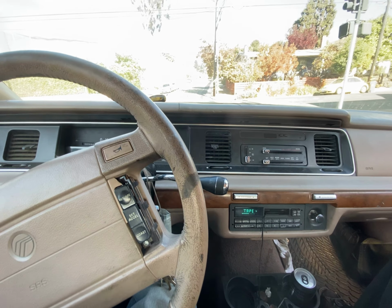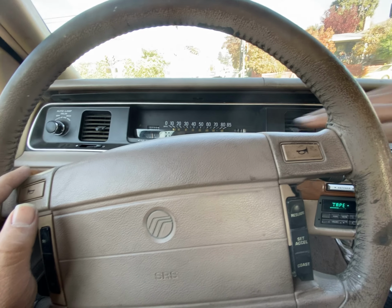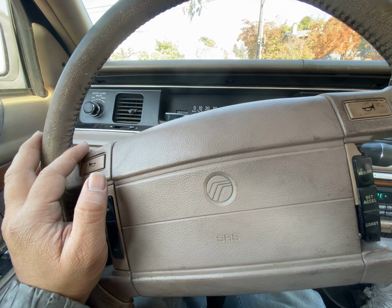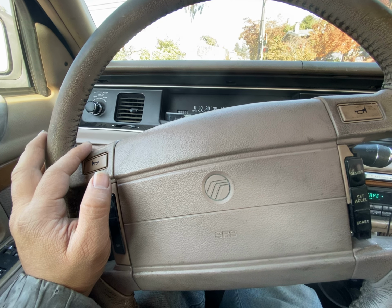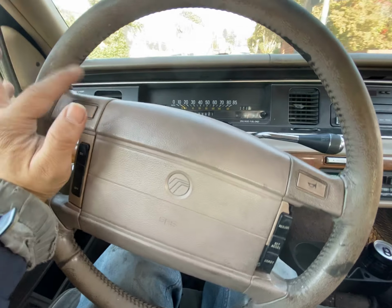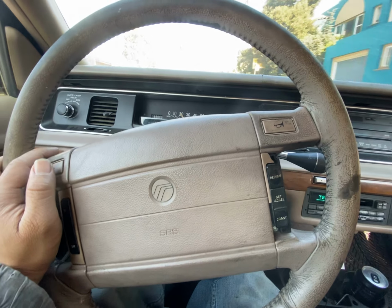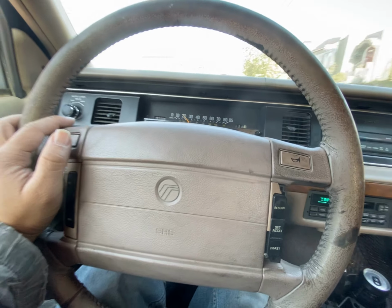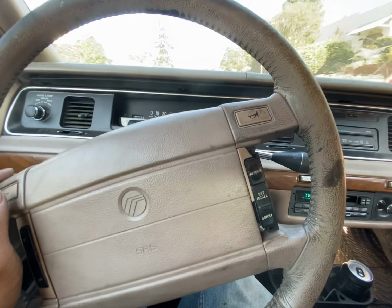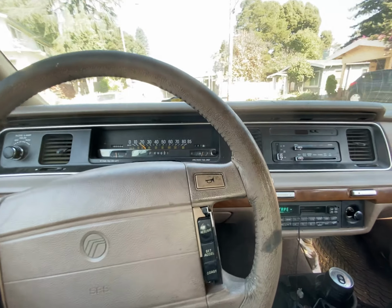And I was thinking it might be a wire, because you know how this gauge here has nothing to do with the ECU. That's a completely separate system. And that thing fluctuates way faster than the coolant temperature could change. So normally there's one system just to tell you that, and the other one tells the computer what the temperature is. There are two separate sensors. So one's for the gauge and one's for the computer. So I'm thinking, all those wires I disrupted when I did the intake, maybe one of them's half broken or something. Gotcha.